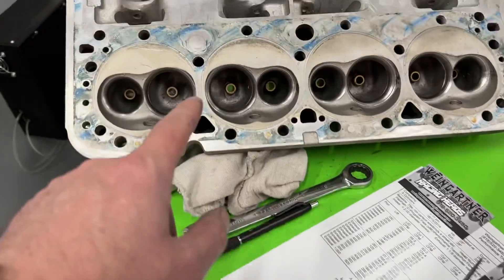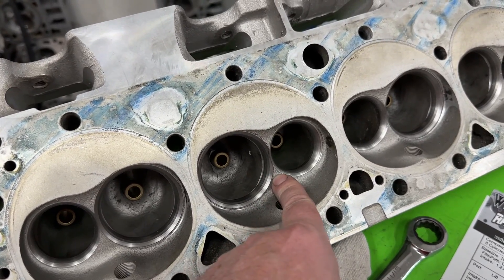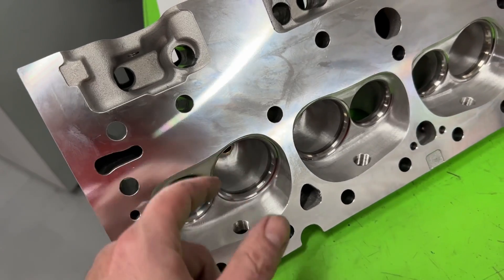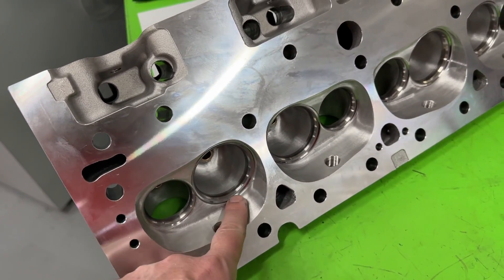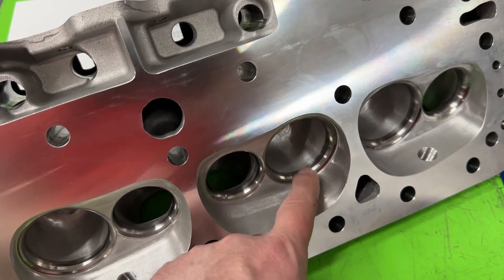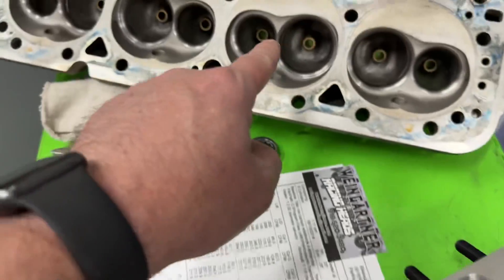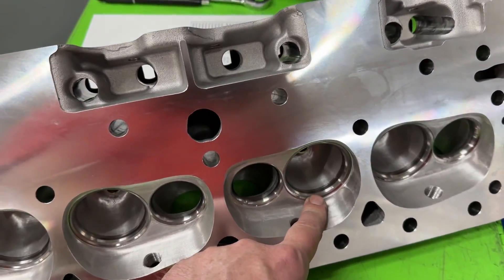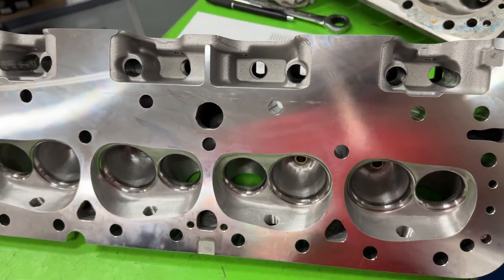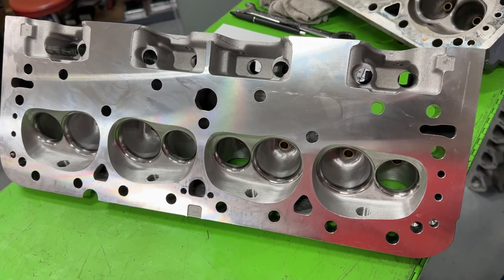The other disadvantage of powdered metal seats is that on a ductile iron seat, when you have a tuning problem, they'll burn out — they don't necessarily chip out, they'll just burn. These powdered metal ones actually come out in chips because it's a harder, more brittle material — it literally comes out in chunks. Usually when you see powdered metal seats, they're the ones that chip out. Pro Comp Chinese heads have the same issue. Edelbrock probably uses better material than Pro Comp, but it's not near as good as ductile iron. Brodix uses this same powdered metal seat material on their IK heads to save cost, but on their Dragon Slayers and everything else, they use ductile iron.